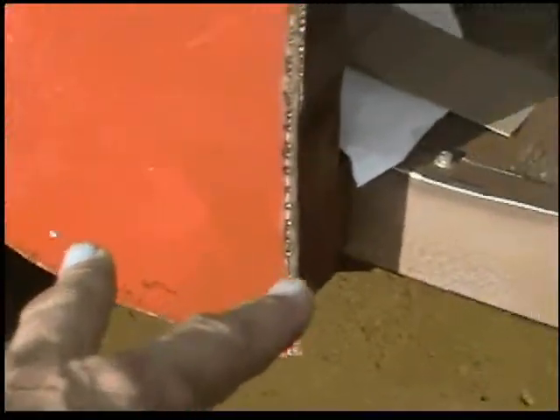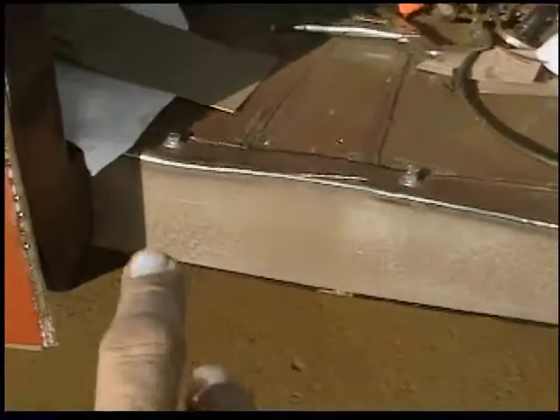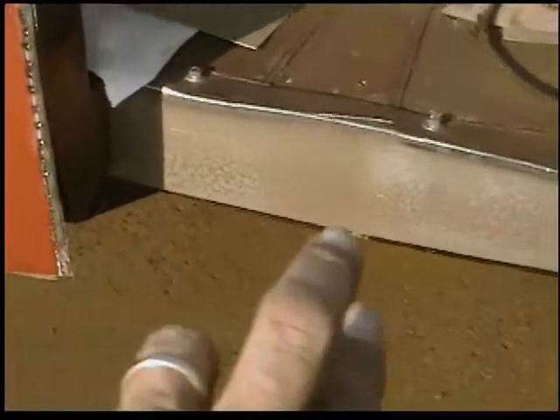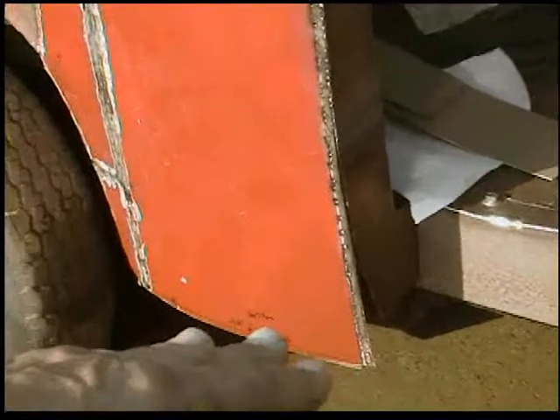What I'm going to do now, before I tie in this section here, I need the piece that goes underneath the door. There's a small section that goes underneath the door, which makes the gap between the bottom of the passenger door and the actual bottom of the rocker panel — it's just a thin strip. It starts over here at the rocker panel in the front, but it was all rotted out so I cut that out. So what I'm going to do now is make a template of the driver's side front rocker, trace it under the metal, and then tack it in over here. That'll give me this shape. Once I have this piece, then I can add that strip which goes from here underneath the door, which will give me a location where this has to come in and what it has to weld to.